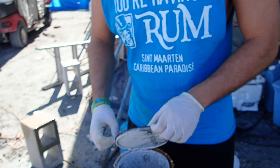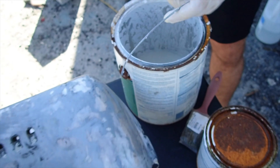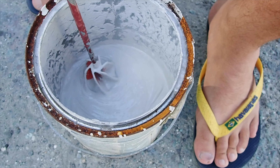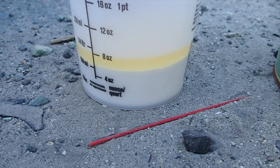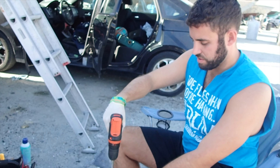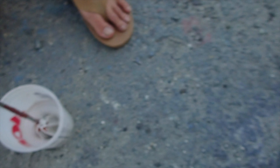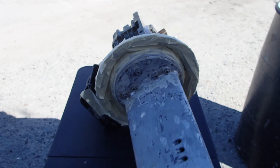Day two with our new slash used sail drive. Alan's putting on the bailing wire — that's part of the step so we don't lose the pieces. We'll fiddle that through on each side. Then we are going to put on a layer of Interlux 2000E — we've got some left from the keel and rudder. We've gotten this piece sanded and just to make it seal a little better, even though it's got the seal in there, we want to get that layer on top overlapping it to help keep the oil and water in.